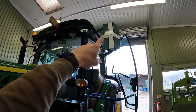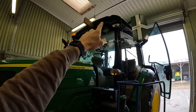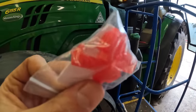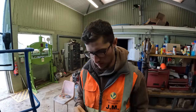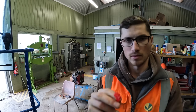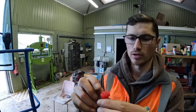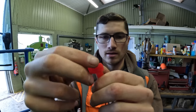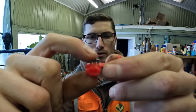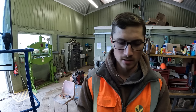We've now got the mirror, the bracket, and also the side rail all bolted back to the pillar. I've fully committed myself because I've cut the wire — just need to strip that back and do some wiring. These are the little connectors we use to splice into the wire. Craig found them. Basically there are two holes on one side for cables to go in, and on the other side there's a butt end. You put your existing cable into the top side, clip that in, and put your new cable in the bottom. Then you get a set of pliers and clamp down as hard as you can — that splices down into the wires — then fold the tab over and snap it on and it stays together. That way you splice into a cable without physically cutting it and putting spades on anything, so it keeps it very neat.